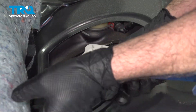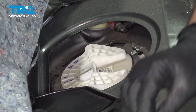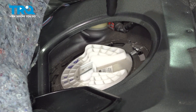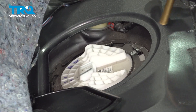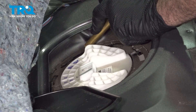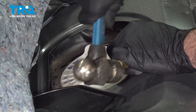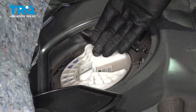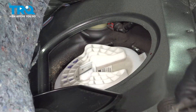This should allow you a little more room to get in once you pull that connector off. There is a metal lock ring on the top here. Do not use a screwdriver and hammer, because if there are fuel vapors and you create a spark, you're going to have a big problem. Make sure you use a brass punch or the proper lock collar tool to loosen and remove that. The collar itself comes off in a counterclockwise rotation. As you lift this up, the fuel pump itself may spring up — it is spring loaded, but it's only going to pop up about an inch. Go ahead and set this aside.